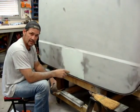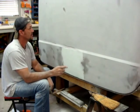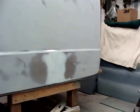I'm going to work on this a little bit more until I smooth it out the best I can. Then I'm going to hit it with some epoxy primer and three coats of the 2K high build, then go from there and see what we're looking like. Had to put two more coats of the Evercoat on here — got it looking real good. There's a few small spots I noticed, but I guess the high build will take care of that. Then the three coats of high build primer will take care of some small things when I go to block it out, put a guide coat on it, and look at it from there.